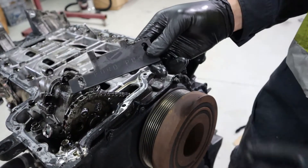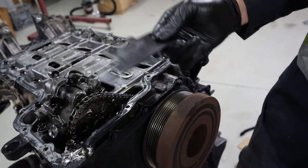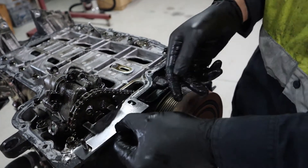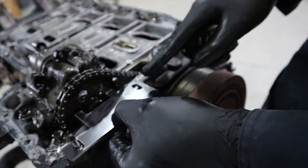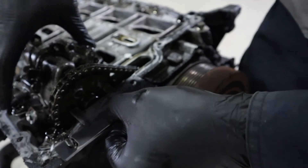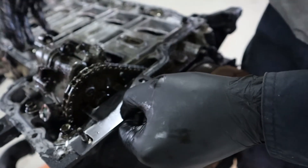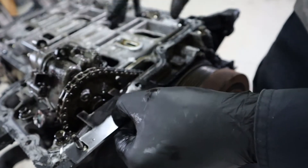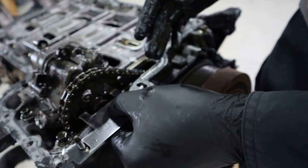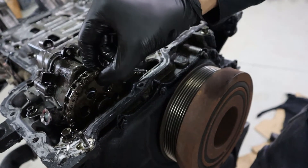This special tool is used to align the oil pump chain back to factory alignment. Normally, before you pull off the oil pump you put on the special tool — the prongs on the tool meet up against the face of the oil pump sprocket. You bolt it down, remove the old pump, and when you fit the new oil pump the sprocket meets the prongs again so you can tighten it up in factory alignment. However, what we found is that the sprocket has detached from the shaft on the oil pump.